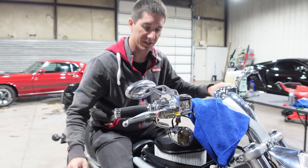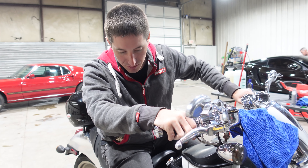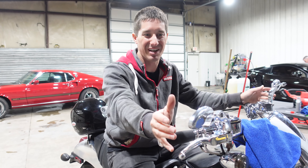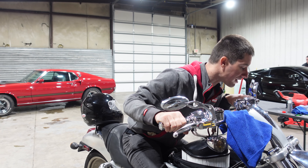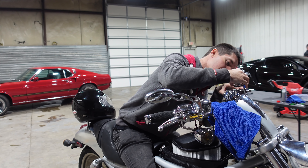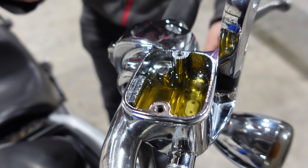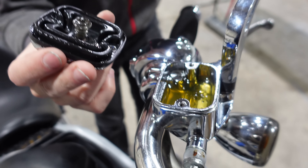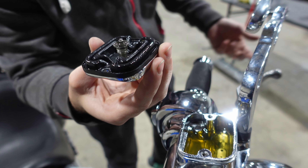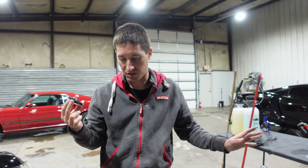It seems like I can reliably find neutral which is the key here. There really is no rear brake at all - it does absolutely nothing. So I think I might look at bleeding that real quick. I've got all new everything coming for that. I'm going to put just a little more in this reservoir to replace what we took out - we're a little below the fill line. I also cleaned out the little sight glass so you can actually use it - these get dirty and then you can't see anything. A lot of cleaning on the cover. Let's fill it back up and hopefully the clutch is way better.